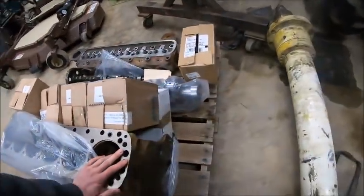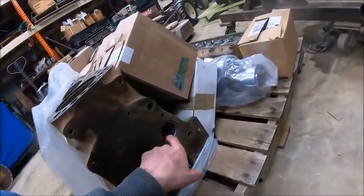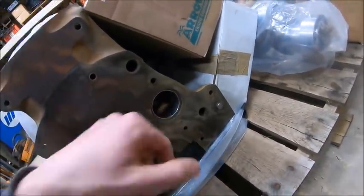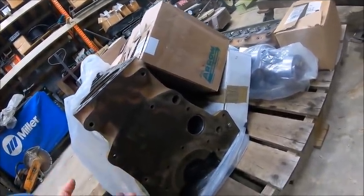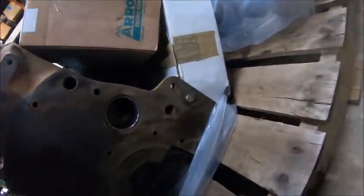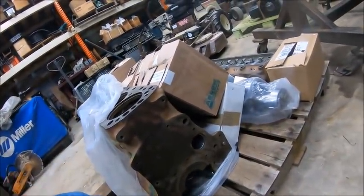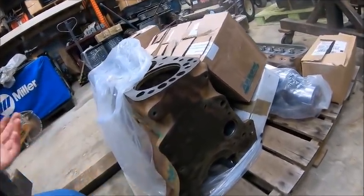They checked the line bore. Line bore was good. He pulled in the new cam bearings. So we're good there. We could have pulled the cam bearings in, but it was in the shop. They have all the cam bearing pullers and everything to do it. They can pull them in, and if they screw them up, they owe me new cam bearings. If I screwed them up, I owe myself new cam bearings. So if you got all the tools to do it, it's just easier.